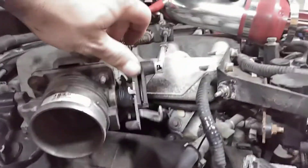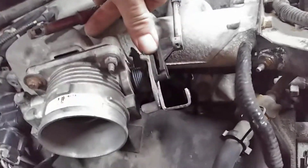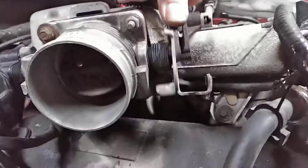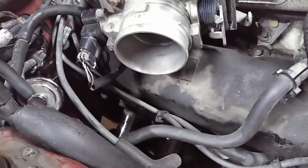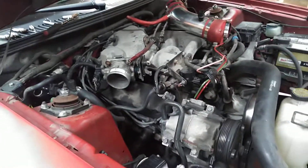Like I said, what I've got to replace is the throttle cable — get the GT one. This has zero clearance issues, does not hit anything, opens up fully. That's all you've got to do, and the cold air intake will bolt right to it and you'll be good to go. So a little tip there for anybody wanting to upgrade the throttle body — just grab one off a two-valve GT.